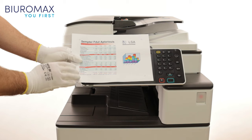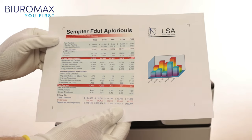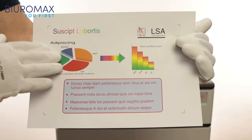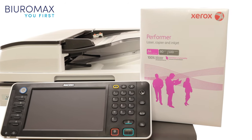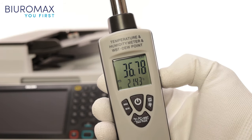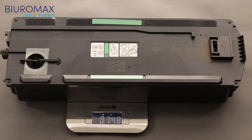The toner is very well fixed and there is no background on the paper. The saturation, intensity, and contrast on the control prints are perfect. The colors are applied evenly and there is no image repetition. The copier correctly prints the full color saturation scale. The compatible toner test was performed on ordinary office paper weighing 80 grams. Final measurements: temperature is 21 degrees Celsius and humidity is about 37%. The waste toner box weighs 748 grams, which means that it contains only 217 grams of waste toner.